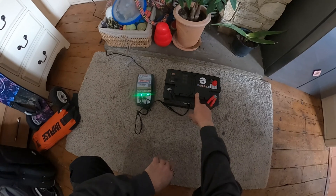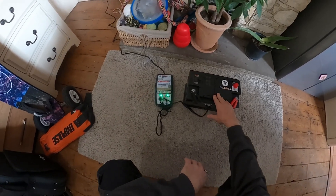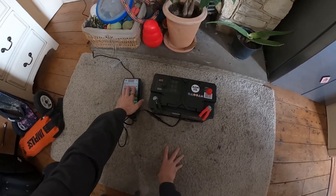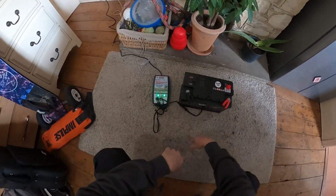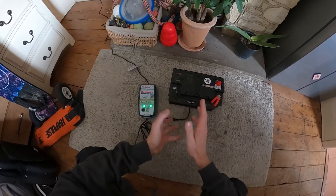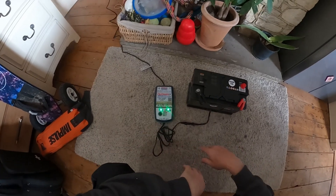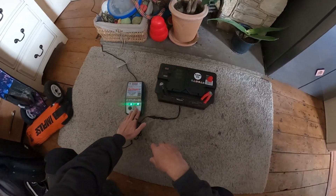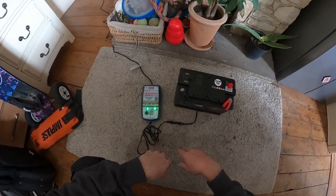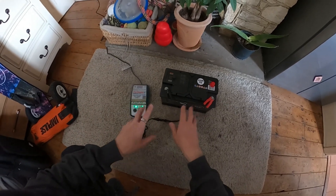Let's put the new battery here — it's a 150 amp-hour AGM, which is the replacement, and I've been charging it for a couple of days on the Optimate. This is an Optimate 7, meaning its highest charging rate is up to 10 amps. It can do a decent charge and will check to make sure it's safe to do so. It will also repair damaged batteries, so it's a really fantastic charger — great for motorcycle batteries and smaller batteries as well.